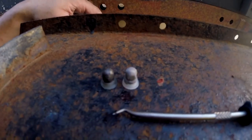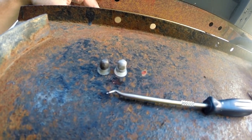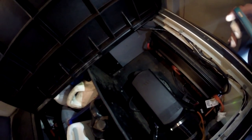I just took out the little screen — the diesel filter for my bunk heater. I'm going to show you how tiny it is. You'll probably need a screwdriver with a little bent pick to get it out. I'm going to show you where this thing goes: this is what it normally looks like — there's a little diesel pump right there, and right at the end is where it goes in. This hose goes into that, and I've got a little filter right in between there to keep the dirt out.